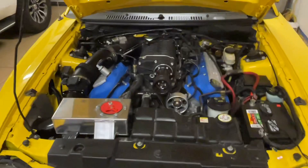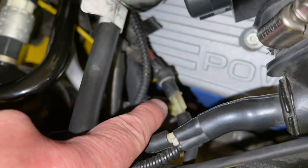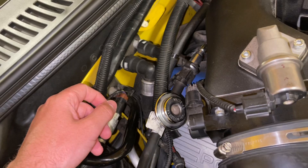The first one we'll talk about is the one in the back of the supercharger. You can see there are three red hard lines, and if you follow one of them they go into this loom. Where they come out is on this little Y fitting — one of these lines goes into the actual car, that black line there, and that's going to operate your air conditioning. When you switch it from floor to vent and all that, that's done off of vacuum.